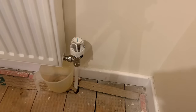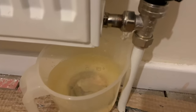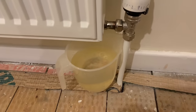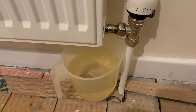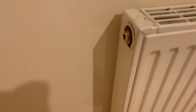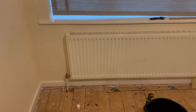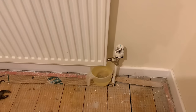As you pull it up you'll see the water starts coming out - that's just draining down now. Once that slows down, we can open the bleed point or use the air tap key on this side, and that will allow air into the radiator so it drains out even quicker.